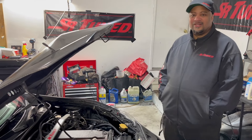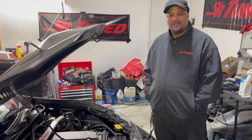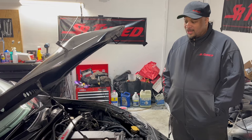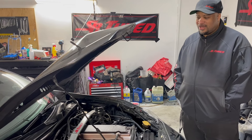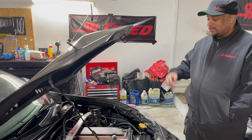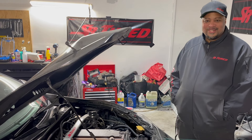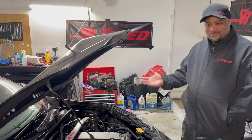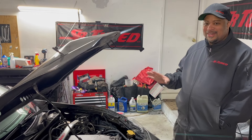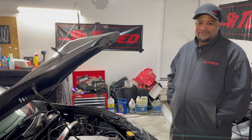What about the stroker kit? I've seen a few still in stock — will it work in this rear-wheel-drive application? I believe it could. Of course, when you're raising compression, you have to adjust for a lot of other things and tuning is everything. A lot of people ask why I'm running such high compression pistons. I like to take risks. Most people run 9:1 compression, which is still considered high, but that's like the native compression of this motor. And it still handles boost well.